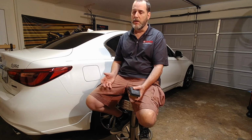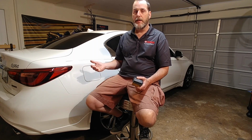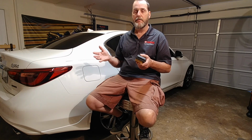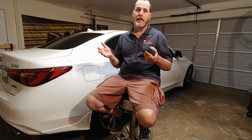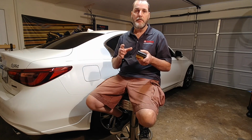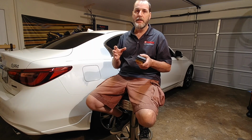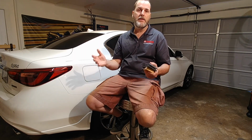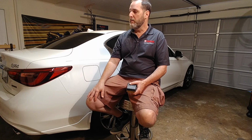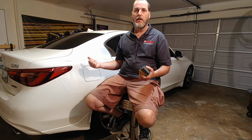It's the most comfortable, and so the trade-off between a welded, solid subframe versus the rubber subframe is having, I guess you could say, the collars in there that limit the movement of the rubber. So the subframe has a little bit of movement to try to dampen some sound and close out some of the bumps. So happy medium. That's where I am now with the collars installed.